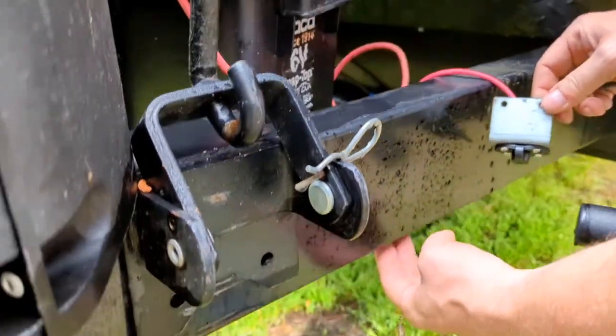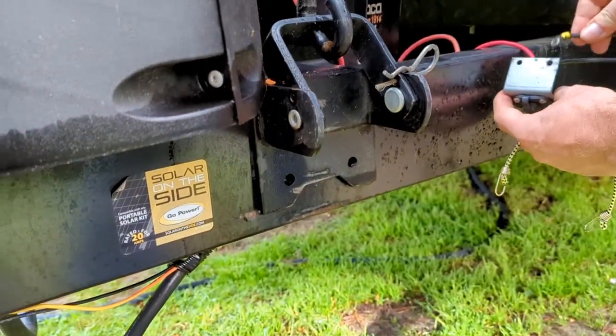We were really happy with that. The second panel was a huge help — it made it so we didn't need to use the side panel at all, which is great because our solar-on-side plug actually broke off on our last camping trip and we haven't had time to repair it. We were really happy that we were able to get our batteries back up to 100% just using the panels on the roof. We do still have to watch our battery consumption, but that seems to have a lot more to do with our battery than our solar setup. The 6 volt golf cart batteries can't be depleted more than 50%, so there are limitations with the lead acid golf cart batteries. But this solar setup did a great job of getting our batteries back up and charged. We're really happy with this upgrade.